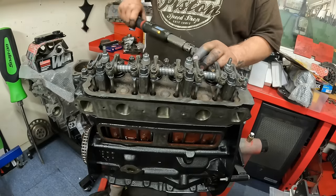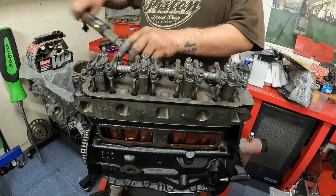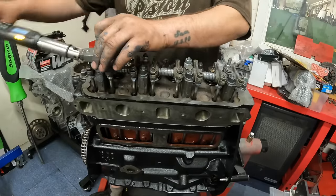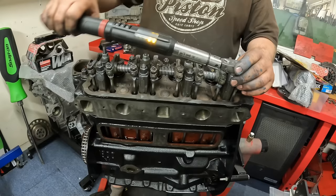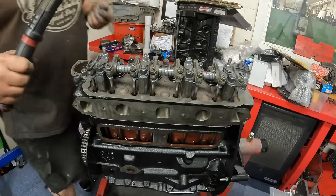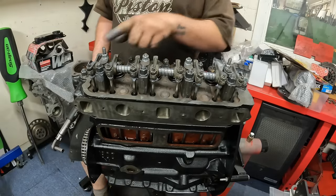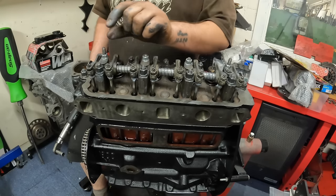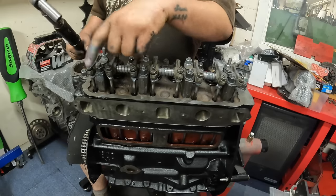And the reason I do 25 foot-pound first is because once I've got 25 foot-pound of torque on all of the nuts, I then check the nuts in the centre. That'll hold the rocker shaft down also. So deep socket on these, because this extra bit of stud that you might notice here and here compared to here and here, this is what the rocker shaft then bolts down to. It has little long nuts that lock the rocker shaft, the rocker cover, sorry, down onto that.